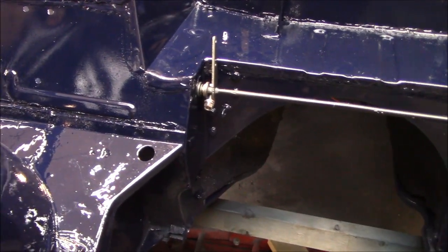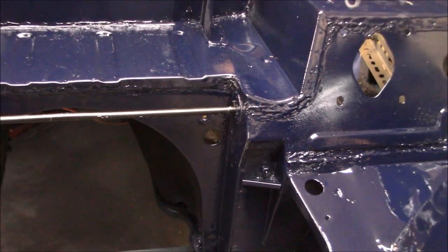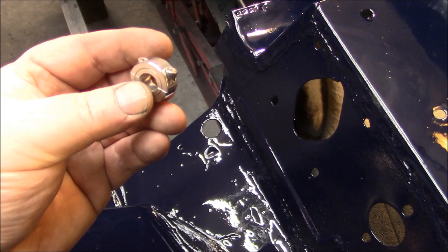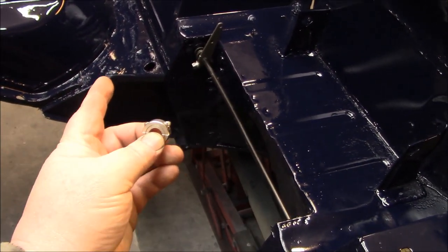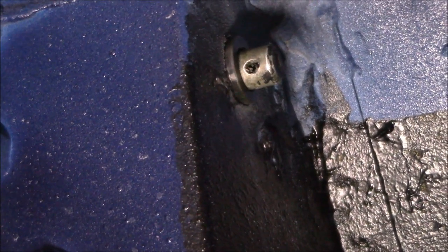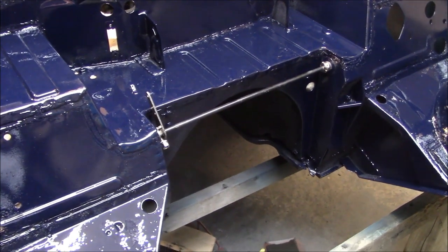That arrangement is now installed. Moving to the driver's side, we're going to put those split nylatron bushings around the throttle shaft and into the hole. The next step is the locking collar for the driver's side — you take the two hex screws out to split it in two. To install it, you apply slight outward pressure on the spring washer on the passenger side, then put the locking collar on and clamp it down. Over in the passenger side footwell you can see the throttle shaft sticking through — we now put a flat washer and split pin to lock the shaft in place.